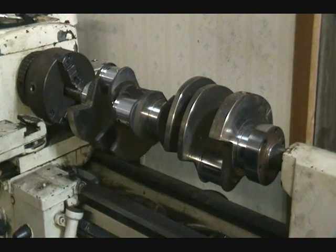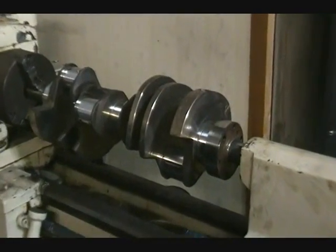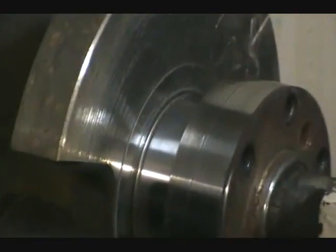How will I know if I can re-polish the crank that I have or if I have to get a different one? The best thing to do is bring it into a machine shop and have them mic it up and check to make sure you're within specs. There are going to be certain scratches that are too deep, and if you go too far into the scratches then the crank itself has to be ground undersize for different size bearings.